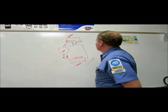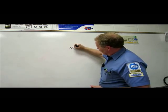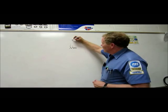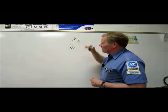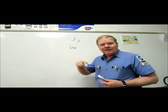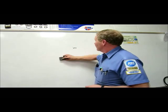Which character of the vehicle identification VIN number indicates the country of origin? I was assuming it was D for number 11. Yeah, number 11 was B. All right, now, on a metric bolt, let me erase this. Everybody's already copied it by now. On a metric bolt, you got your threads here. You're going to measure from there to there in millimeters, and that's what your metric bolt is. So it'll be like 1.25, 1.50, something like that, because it's like 1.25 millimeters. Now on a standard bolt, it's how many times you have to turn it to make it go an inch. See what I'm saying? That's how you do on those. All right, so just remember that. Now that can help people that lose out whenever they're trying to buy bolts, right?